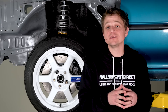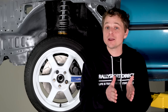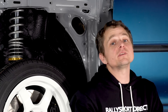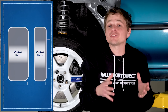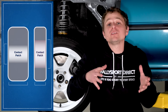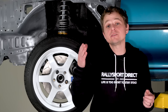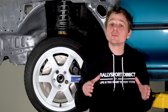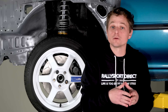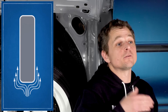Racing out at the salt is very similar to driving in the snow, and you can get traction in the same way — by running a narrow tire inflated to a high pressure. By running a narrow tire, we're effectively trying to reduce the contact patch as much as possible, thereby focusing the weight of the car onto a much smaller area. We can also increase the tire's pressure to the maximum manufacturer recommendation, thereby further focusing that contact patch even more. The smaller the contact patch, the less the rolling resistance, and the frontal area of a skinny tire is also going to offer less drag.